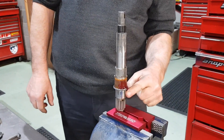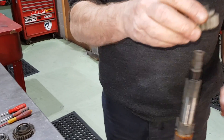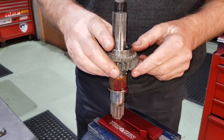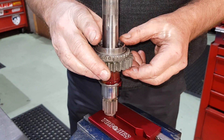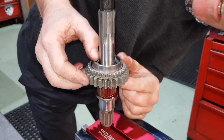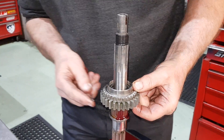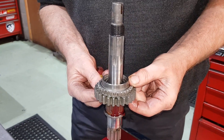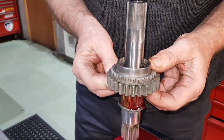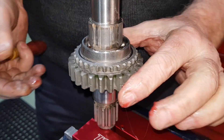First gear goes here, so this is second gear. We need second gear out of the Clubman gear set — washed off, ready to fit. Drop it down over there and you'll find it will locate underneath on the two pins. Compress one of the pins using a little screwdriver, pop the pin in — there you go. That's on in place now.